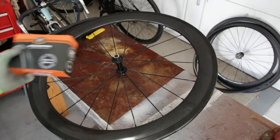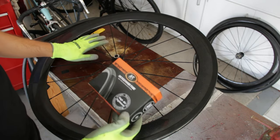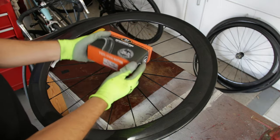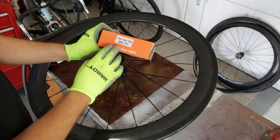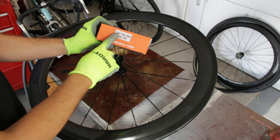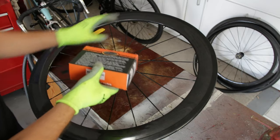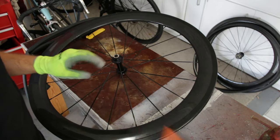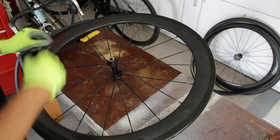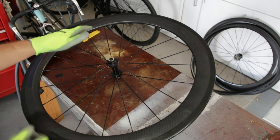So, okay, we're back. And I finally got some inner tubes with long enough valves to work with these 60 millimeter carbon rims. These are the inner tubes. I can put a link in the description if you want, but they have 80 millimeter long valves. So these should work for 700C 18 to 25 millimeter wide tires. And that's actually what we have today, some 25 millimeter wide tires. There's some used ones, but they should be in decent enough condition to work today. So let me go ahead and grab one of those and we'll try to mount the tire onto the wheel.